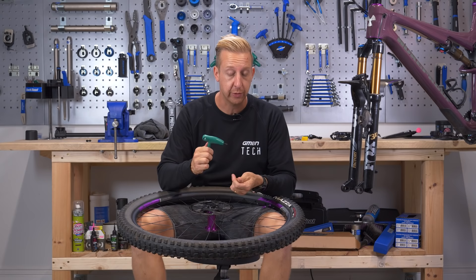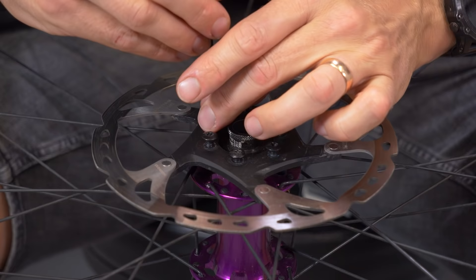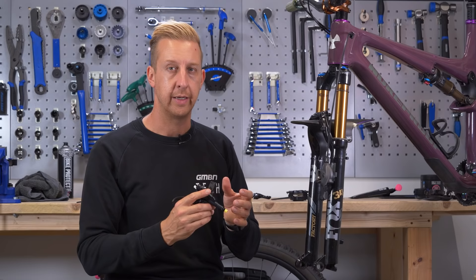As we have the wheel here, we're going to install the disc rotor first. Pretty simple affair — this one is a six-bolt. Just nestle it in place, then using a Torx T25, loosely to start with, get all the bolts in to make sure everything lines up. You don't want to put any stress on the threads, particularly if you have an expensive hub. If possible, always use fresh bolts because they come with thread lock already on them. Take care that you've got the orientation of the disc the correct way — this disc actually has 'rotation' written on it, which makes it obvious.